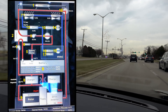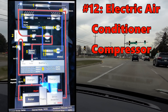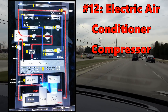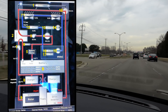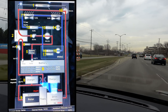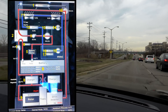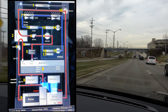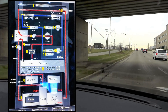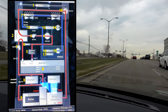Number 12: electric air conditioner compressor. It runs on high voltage and is used for two purposes: to cool the air for the cabin using number 16, and/or to cool the glycol loop using number 13. Percents indicate compressor running speed. If cooling requirements are very small, the compressor will be temporarily stopped to allow the cabin air evaporator to stay above the freezing point. Sensors before and after indicate temperature and pressure of the refrigerant before and after the compressor.